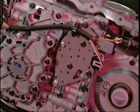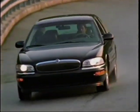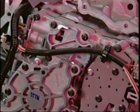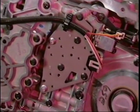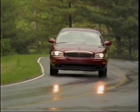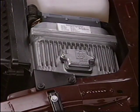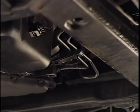It prevents the transmission of engine torsionals to the drivetrain. It also eliminates powertrain-induced chuggle and enables lower apply speeds to increase fuel efficiency. Reduced hydraulic circuit restrictions and redesigned accumulators allow more effective control strategies. Adaptive controls monitor shift duration and automatically compensate for engine break-in and any transmission wear during the entire service life. The powertrain control module's memory has been doubled to provide the capacity for future diagnostic refinements. As for cooling, one-piece transmission oil cooler lines provide reduced leaks and assembly time.